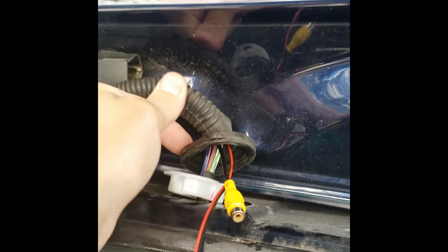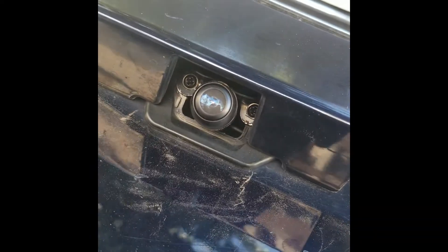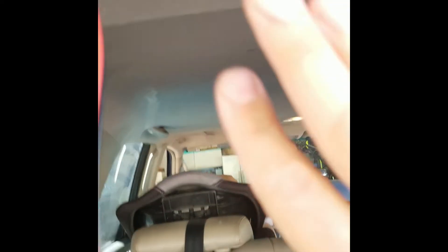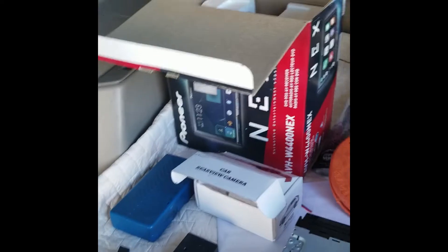You're going to need your 10-millimeter. Rule of thumb: try to follow the factory harnessing. 4Runners have a window that likes to roll up and down, and we don't want that cutting or tearing our wire — be extra careful. All of these fasteners are going to have to come loose to pull the beauty panel off, which houses the camera underneath. We have everything pulled through, everything's re-clipped together. I used strip caulk to seal the camera in the door — it's covered and won't get rain on it.